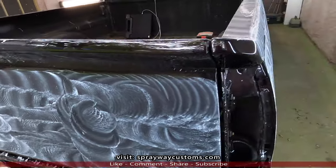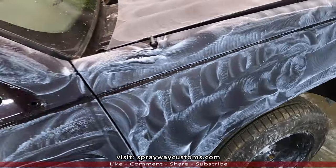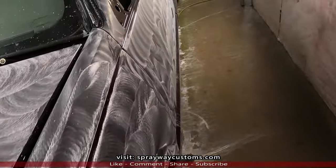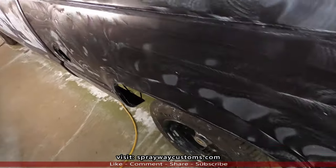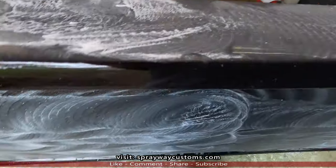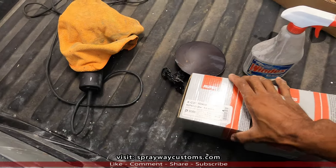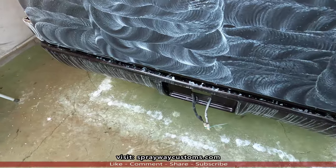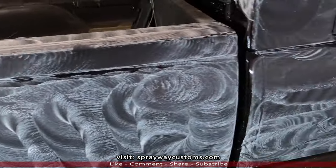Here's all the 2000 residue on the DA — same thing as sanding paste. It's actually the clear turned into paste. Now I'll take my rag and wipe this down. I could move up to 3000 — that would just make my buffing a lot faster — but I'm going to skip the 3000 and go straight to buffing. Like I said, I always like to do it different each time. Here's the 3000, here's the 1500 — we're going to skip the 3000 this time. Once I wipe this down, I'll gather up all my buffing stuff and then we'll get started with the buffing.